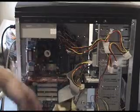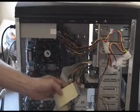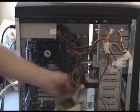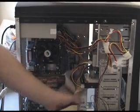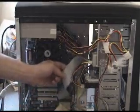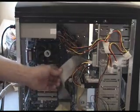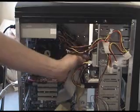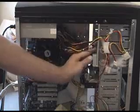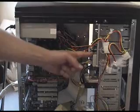Graphics card, RAM, cooler, our hard drive, which is on IDE channel 0, the first IDE channel, on the 80 strand cable, and it's on the last connector, the black one, the middle one being left for the secondary device if we add one. The CD-ROM is on the second IDE channel, IDE 1, and that's using an older 40 strand cable, and it's connected using the first connector working up the cable, with the last one being left free.